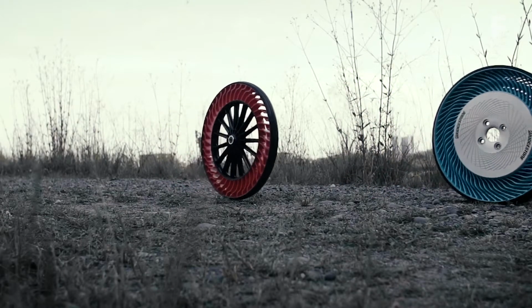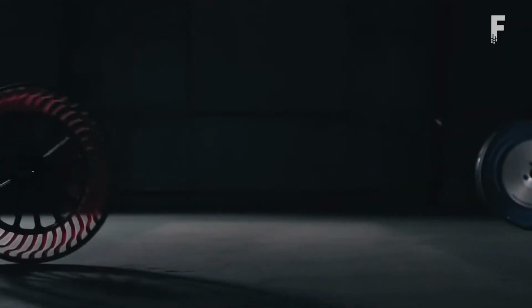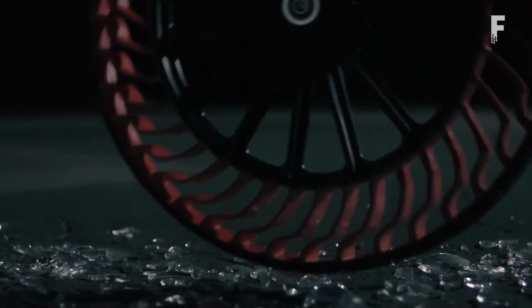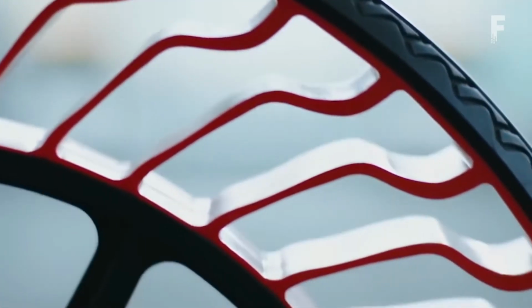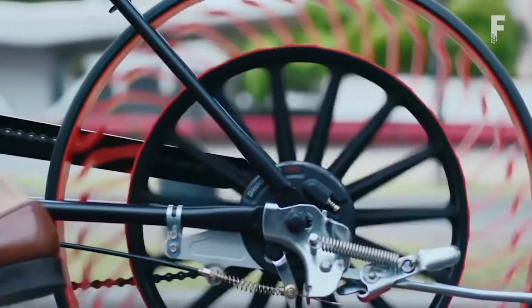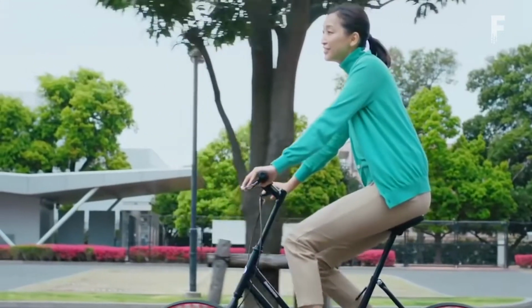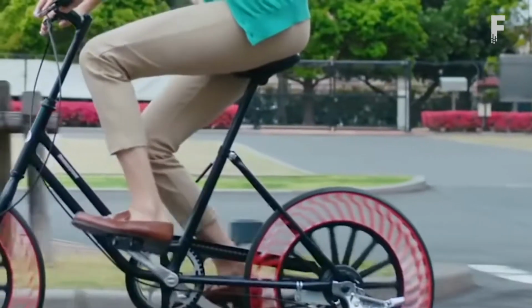The air-free concept is a technology that eliminates the need for tires to be inflated with air to support the weight, using a unique structure of spokes stretching along the inner sides of tires. With this technology, tires need less maintenance and have no worry of punctures. The resin spokes with air-free concept technology provide higher flexibility for design and recyclability than conventional tires.